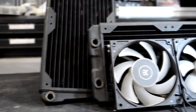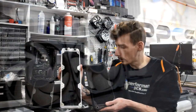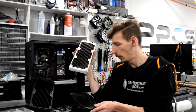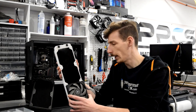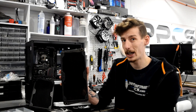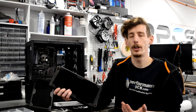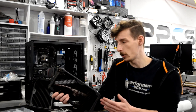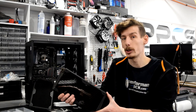You might be asking yourself: do I need the 360 or a 280? Overall both would have pretty similar cooling performance based on their size. However, always make note of the overall design of the radiator. This 360 is nearly the same width as its fans, whereas this 280 millimeter radiator has quite a bit of channel capacity on either side making it actually quite a bit wider than 280 millimeters. So I always recommend checking the manufacturer's case specifications as well as measuring if you have the case on hand, since radiators can be wider than your actual fans.